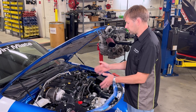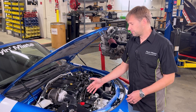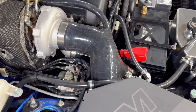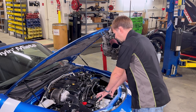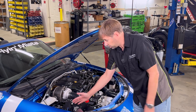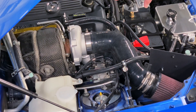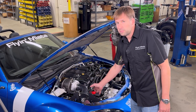One of the first things we looked at when designing the turbo kit is where to put the air filter. We want it to suck in the coolest air possible — cold air is more dense, that's more oxygen, more power, quicker spool for the turbo. So we wanted to get it as far away from any potential heat sources as possible: the exhaust, the turbo, the radiator, and the engine itself. We stuck it here in as cool a corner as we could get, and we put a baffle around it so that it was mostly sealed off from the engine bay and the hot air in it. It's got a good supply of cold air from underneath the headlight.